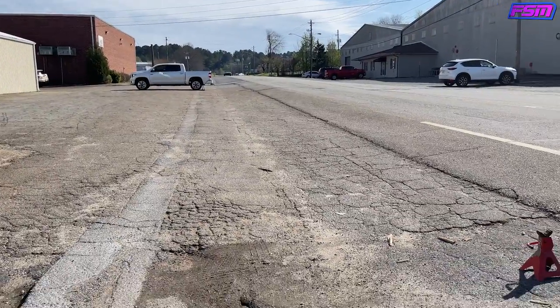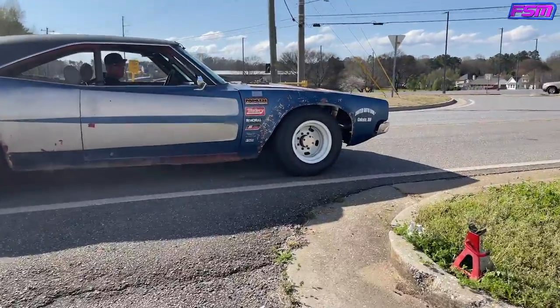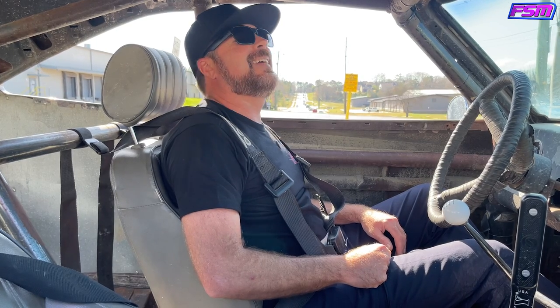That's 60 miles an hour. I threshold-braked and did pretty good — it didn't totally lock up till the end. The first time was much better; I don't think the drum brakes like the heat. The first time I only got to about 58 and hit it early because I was scared. This one I was definitely at 60 and waited until I saw the truck. We'll split the difference and measure in between these two. Let's go home and fix this — this thing sucks.